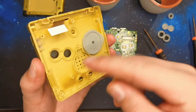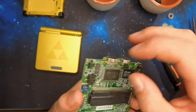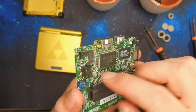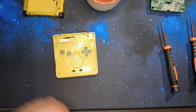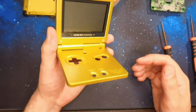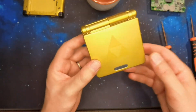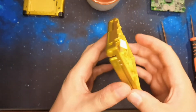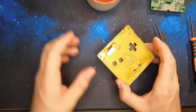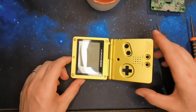Take the opportunity to clean it, change any buttons that aren't working, etc. If you have a little soldering skill it's really not difficult at all. You have the L and R buttons here, and A and B there if you need to change them. Now set the motherboard aside if you have repairs to do on it — this is the moment. Now we're going to try to remove the screen without losing the buttons, because today they're a bit complicated to find. On AliExpress you can find brand new shells — I've seen Super NES edition shells and even Pokémon Ruby and Sapphire edition models. Now we begin removing the old screen.